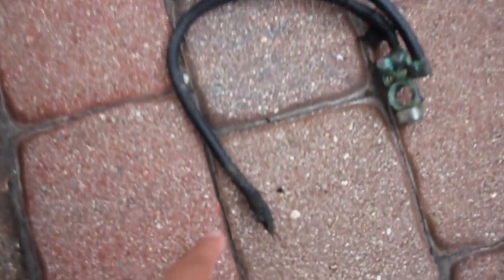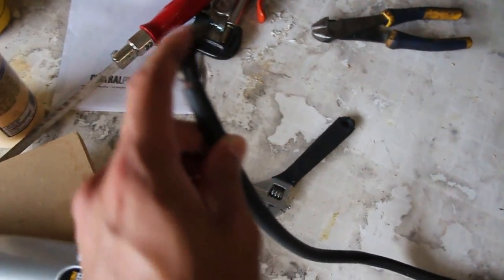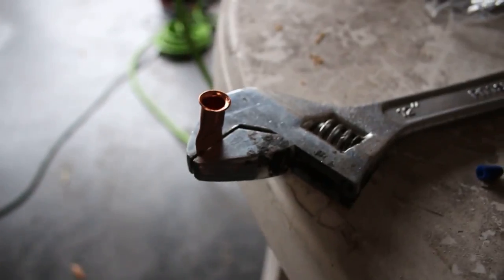The old ground is out. You unbolt this one, it screws in over there on the corner, take it out, and cut it — then we relocate it. Make sure wherever you're putting your grounds you want no paint on the area; you want bare metal, otherwise you'll have problems. Sand it out really good and get all the paint off. This is our ground cable — the one side goes to the starter, and we're adding another terminal on this side so we can ground it to the frame.